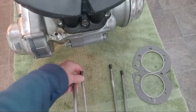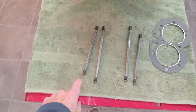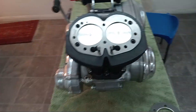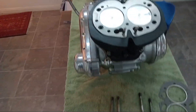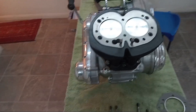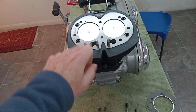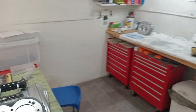I've got a lot of assembly lube on the cups down on the tappets and the cam followers. Later on we'll pour some oil down so we've got lots of oil around the cam followers at the bottom. For now I'm just going to clean things up, put some well seal on, and have a go at getting the head on the barrels.